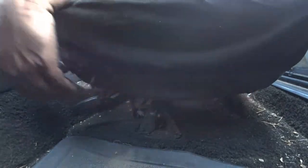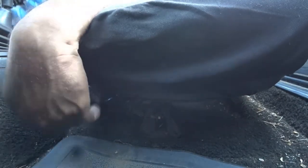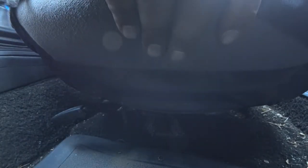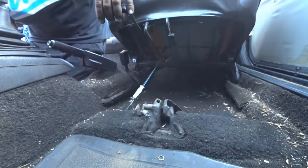This is the driver's side — same thing, just a 10 mil nut. Pull the seat forward about an inch. It's just a 10 millimeter nut and it doesn't go on very hard. Hold the seat back so it pops out.